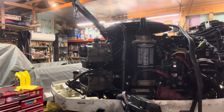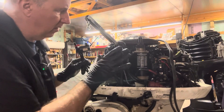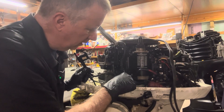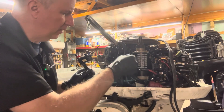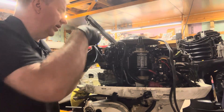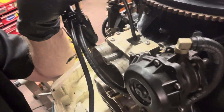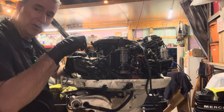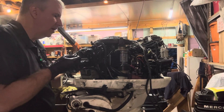Now we'll do this bottom fuel line. We have our primer solenoid, we've got all of our fuel lines hooked up. This is our oil line here — I don't want to put a bolt right in this spot, so I'll figure out the best place. I might cut it off back here somewhere and put a bolt in it with a clamp. Our primer solenoid got mounted on this side, so now we need to hook up our tubing to our carburetors — that's where they get connected, on the little brass fitting on top of the carburetor. I have the top carburetor off again because I should have put the bottom one on first and put the primer solenoid on. Oh well — sometimes I have to do things twice.